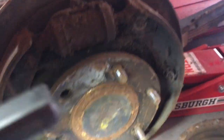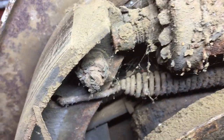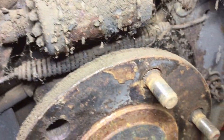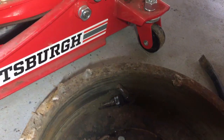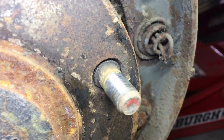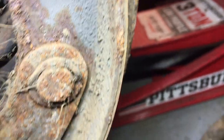Much drier on the passenger side — no grease. There's a castle nut-type thing there, which was under all the grease on the other side, but it's the same on this side so I guess that's normal for this brake setup. The drum looks pretty clean inside. There's still meat on the pads but not very much — looks like about a sixteenth of an inch or three thirty-seconds. Very thin, so it's about to hit metal.